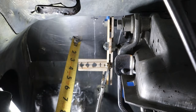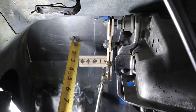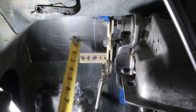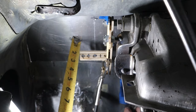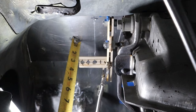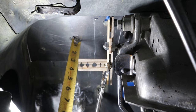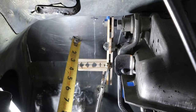I hope I got a decent angle here for you - it's really hard to get the camera in here. I've got a tape measure right there and you can see it's up against the stop at about three and an eighth. We'll go forward to two and an eighth and that'll be an inch of stroke, then two for inch and an eighth, then one more eighth for inch and a quarter. Then the pedal bottoms out at inch and three-eighths - so we got an inch and three-eighths of stroke. I'm feeling really good about that. Obviously we don't want to bottom out that master cylinder, but I can always put a positive stop back here somewhere. I did my math right - so let's take this off and it's time to start manufacturing some real parts.